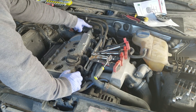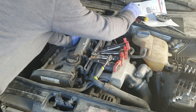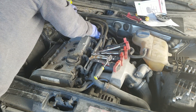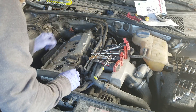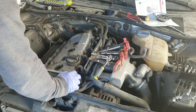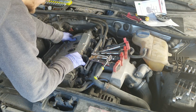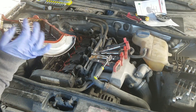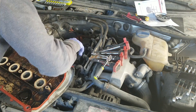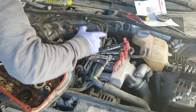Back here you have your crankcase breather and all you're gonna do is remove this screw clamp back here and slide it off the back. Just slide that out of the way. You should be able to pull your valve cover off. You should never really have to pry a valve cover off — it may be a little bit stuck, but I've done that once before and it actually cracked it. There we go, that is off. The engine looks pretty good. These engines build up sludge and if you see it up here you've got a problem, but this one looks good.